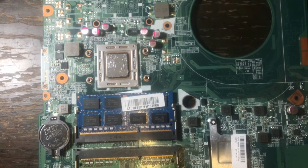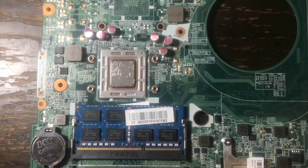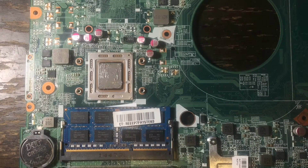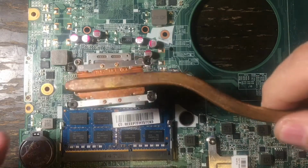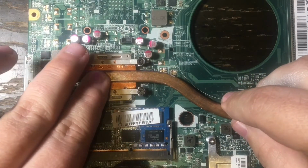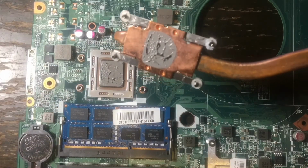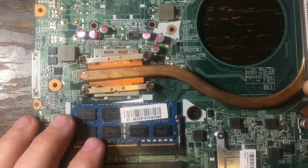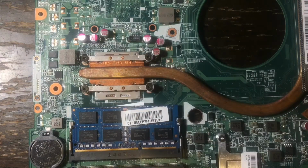And then I'm going to go to the next step. The next step, I'm actually going to take the heatsink and fan, and I'm going to put a drop on there. Hold on one second and I'll show you. Okay, here is the heatsink. I've put a dab of thermal paste on there, and then I pull it back off, and you can see how it shows me that it is connecting to the APU in a very good surface area. So since I know it is conducting well, I'm going to screw the heatsink down.